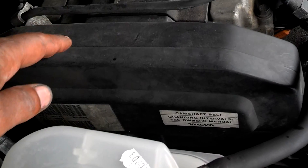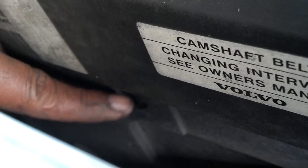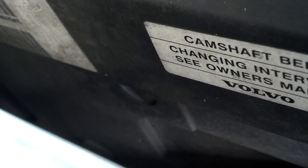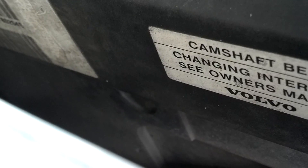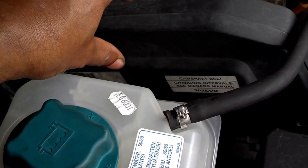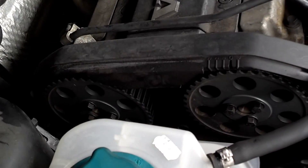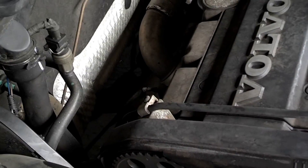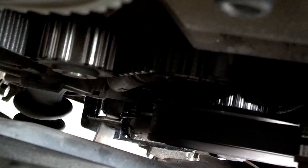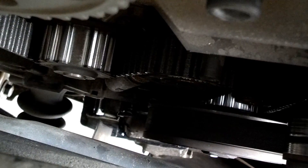Next, remove the timing belt cover. Down here there's a little notch where you can feel the screw for the timing belt cover — it's either 10mm or 12mm; on this car it's a 10mm. Take that front timing belt cover off; once the bolt is loose the cover just lifts right off — grab it with two hands and pull it up. Once the cover is off, look down in there to see if you see any coolant. If you see coolant, stop and get a water pump if you don't already have one.